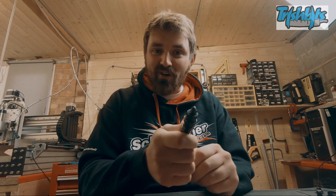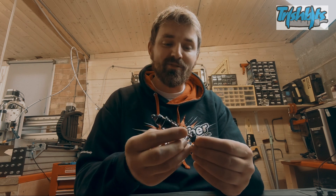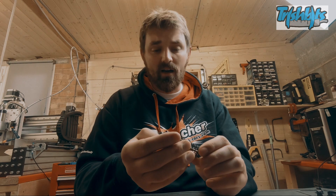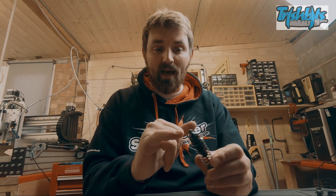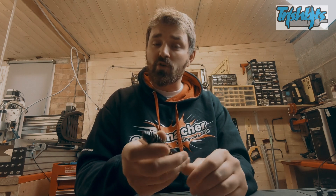If you've enjoyed that, don't forget to subscribe and click like. Just have a go - rebuild your shocks more than you think you should. A lot of you leave them for a very long time and wonder why your car doesn't handle as well as it used to. No matter what brand of car you drive, replacing your o-rings and oil from time to time is a big thing. Check the condition of the shafts - they can get scratched and wear off their outer lining. Replace the caps if they've elongated, replace the bottom ball cup from time to time, and if you've stripped the thread, replace the top. Don't give yourself second-class racing - make it really good quality.